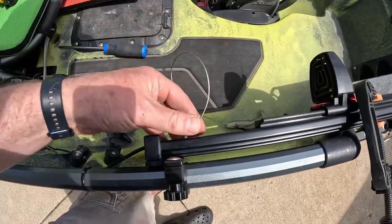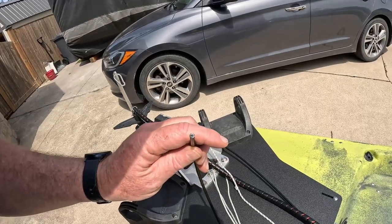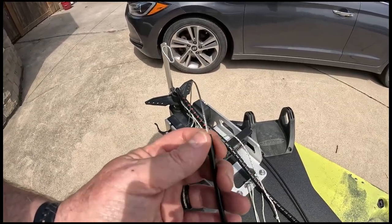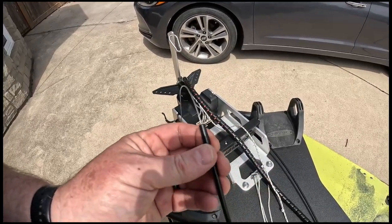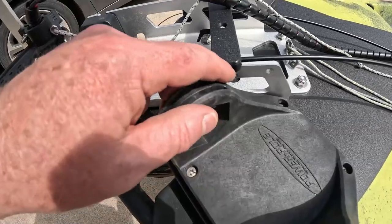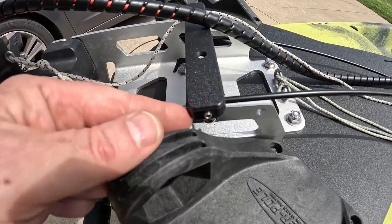Simply grab onto the cable back a few feet out. Once we cut the cable housing, don't forget to open up that end so the cable can come through. Now you can slide your cable end cap on — these aren't 100% necessary but they clean up the end; you can find them on Amazon fairly cheaply as 5mm brake cable end caps. Snug up your set screw so the cable doesn't move. Don't over-tighten — this is just into plastic — you want it snug so it doesn't pull out, but not so snug that it collapses the housing.